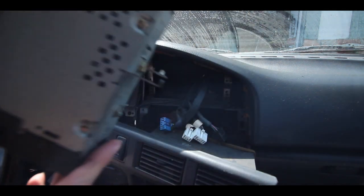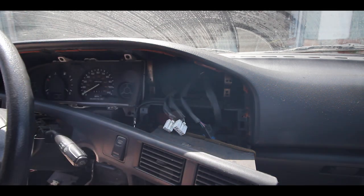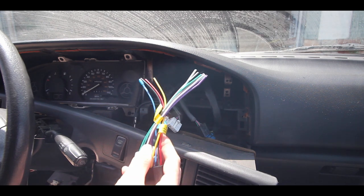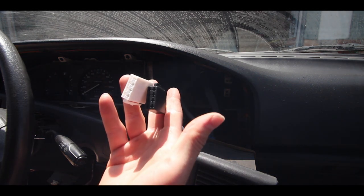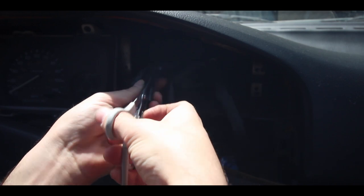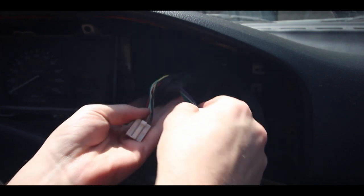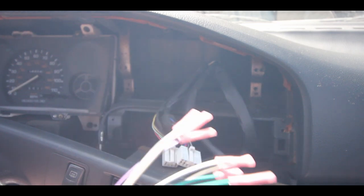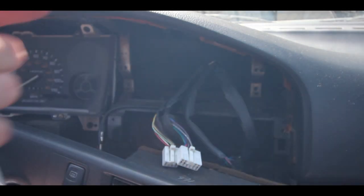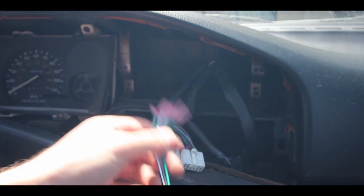Boom, 1991 magic right here. So now what we're gonna do — we got these two plugs that came out of the stock radio. If you go online you can pull up a wiring schematic for your radio so you can match up the new colors with the OEM colors and just splice them together to use the new radio connections. What I went ahead and did was get the new wiring harness and just crimp all these connectors on the start so I don't have to try to crimp both sides in there — now we're just gonna cut these apart, pick the right ones that go together, and crimp them.